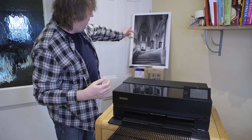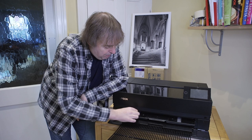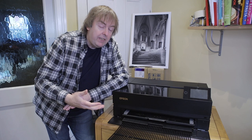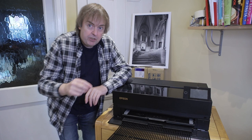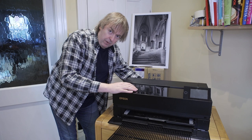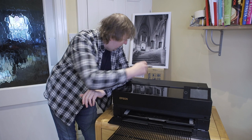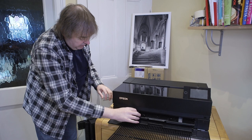You can use thicker paper — indeed this poster board was fed in using the feed at the front here. The front feed is also adjustable in width up to 17 inches, so this A2 sheet is slightly under 17 inches — for example 17x22. You load the sheet in here and it runs through the printer and comes out the back. It's an important feature to remember: if you load paper in the front it goes straight through the printer — that's why I can print on card. That means you can't have the printer flush against a wall if you're going to load paper from the front. Only thicker media, thick art papers and poster board, need to go in through the front; ordinary art paper is fine being loaded at the top.